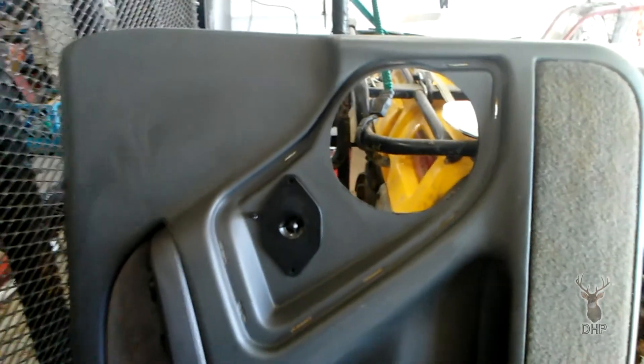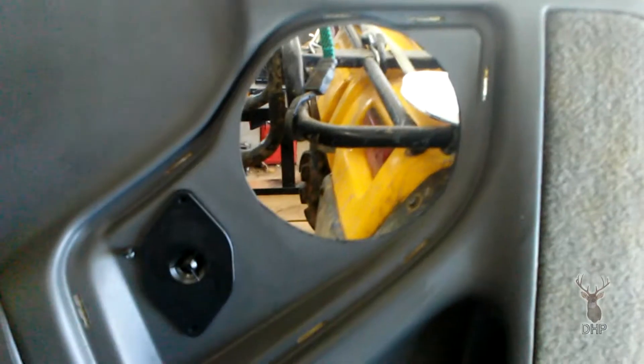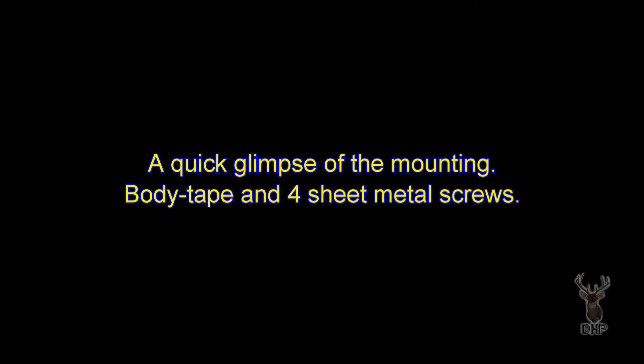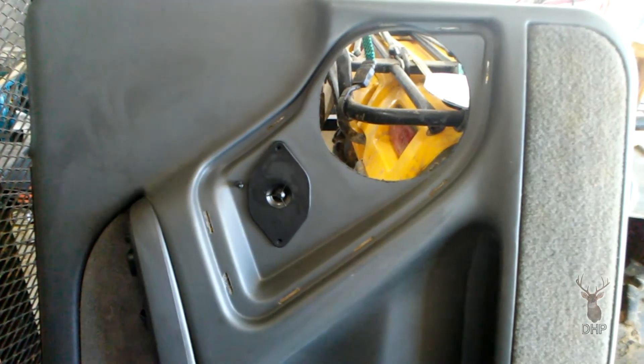This is the remaining door and I think I'm done with it. I've tester-painted the white fiberglass edge, and I even got up under there — not that I need to since I'll never see that white edge unless I'm standing on my head. I've got a six-and-a-half-inch hole now. Whether that's totally needed given the speaker mount depth versus the panel in front of it, it may not bump — but now I've got a good-size hole and it didn't take much time or effort. The speaker won't be in until tomorrow anyway, but let me briefly talk about something I read online.